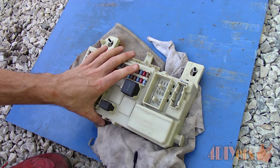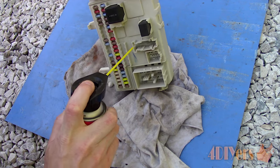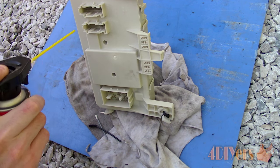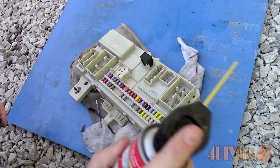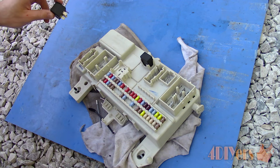Using the same procedure, you can spray down the contacts, then agitate the surface using a brush if needed, and wash away the area again with contact cleaner. I should also mention: use a contact cleaner which is safe on plastics — considering this is a plastic case, we don't want to damage it. I decided to remove both electrical components — I believe these are relays — to clean the connections and verify there is no corrosion.